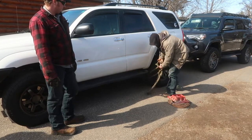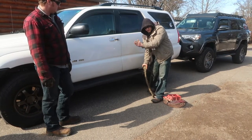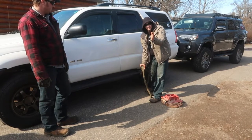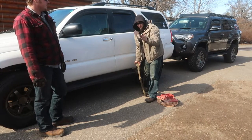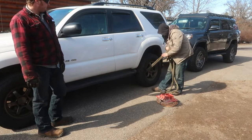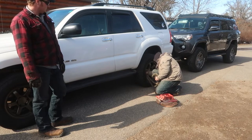And once it's evened out, obviously, then you're going to be pulling like this. It's actually going to drag the car up to the road. And once it's up on the edge of the road, you pull across the road to get it up on the road. Otherwise, if you pull straight along with the shoulder, it's just going to keep it right down the shoulder. If you can, pull as linear with the vehicle as possible, right?